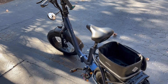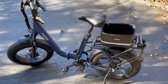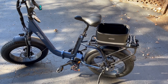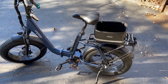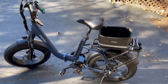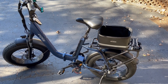The Nesta is my favorite new daily rider. The one issue was that the battery for this 750 watt motor is just a little too small for it. I got about 22 max miles in real-world conditions, so I wanted to add a second battery to make it a long range e-bike. It comes with an XT90 connector inside the control panel, which makes this project easy because I didn't have to cut wires. I'm not an electrician, so I wanted this to be plug and play — and that's what we're going to do today.